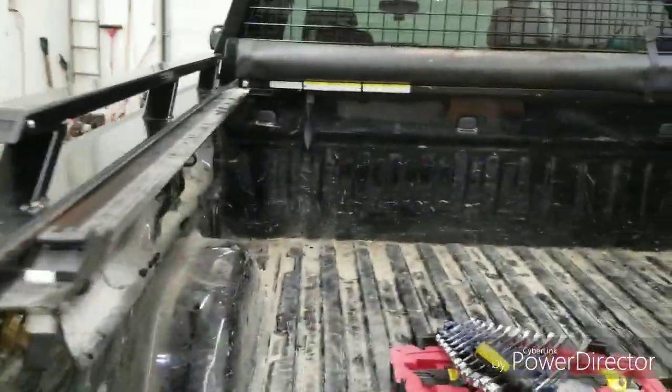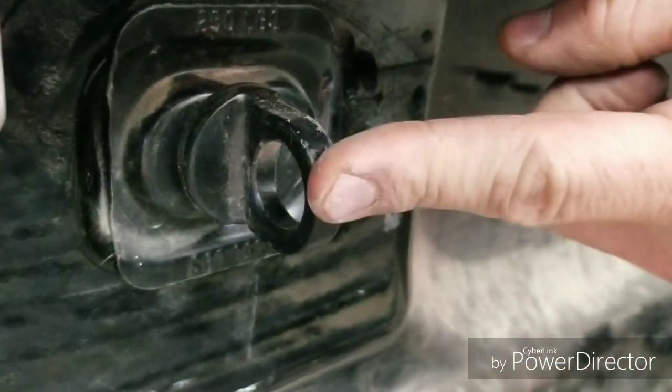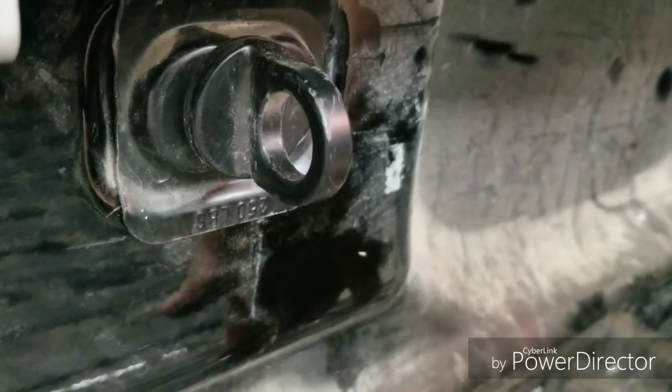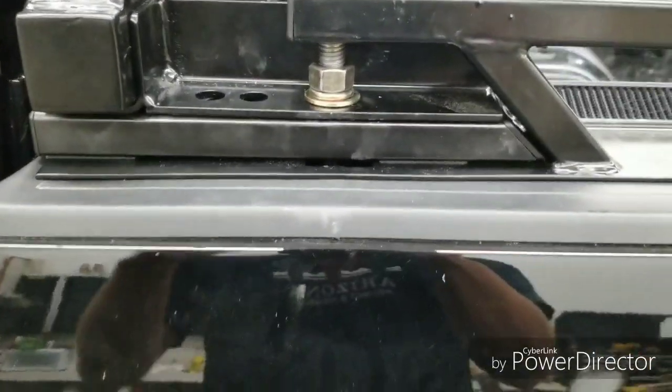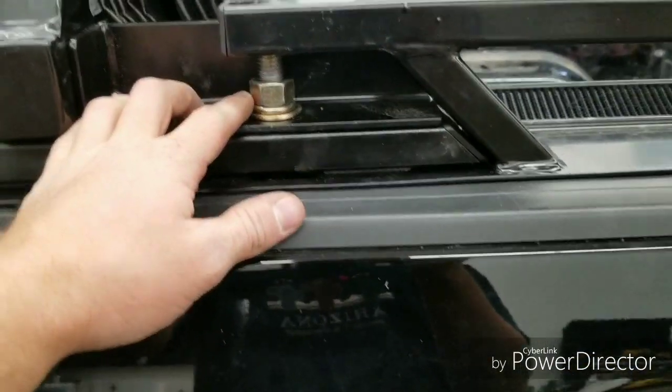And yes, everybody can cut it, but it's nice if it's actually a solid unit. So what had to change? First, you gotta pull off your tonneau cover, get it back to empty, nothing on your truck. In my case, I had 2 of these hooks. And so these actually just turn out. You use a crescent wrench, spin them out. It's kind of like a butterfly drywall anchor. But those were in the front here, so I had to pull them out so I could put the front stake pockets in, which has a big bolt coming up the top. And that's all just fine.